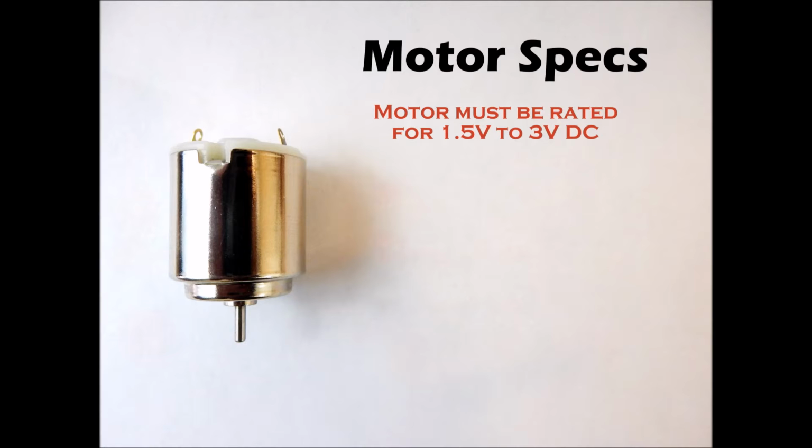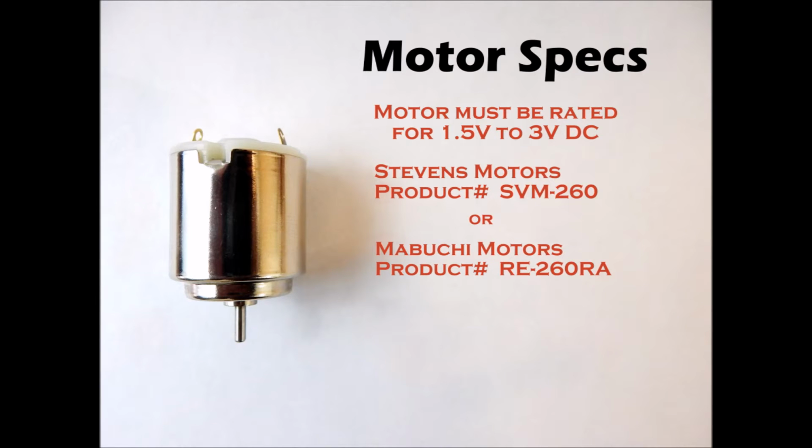Okay, so before I show you how to replace the motor, this graphic shows you the type of motor that's required for this machine. You'll find that's a typical hobby motor that's in a lot of the vintage Tomy games. It's rated for 1.5 volts to 3 volts DC. There are 2 model numbers that should help you find one on the internet. There's Stevens Motors SVM260, out of New Jersey. And then the Mabuchi motor number is RE260RA, and I think there are some other variations on those letters.